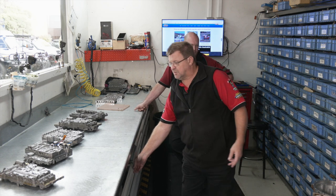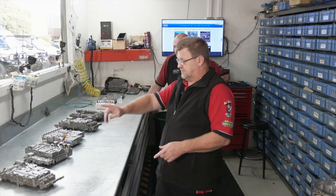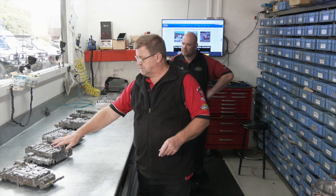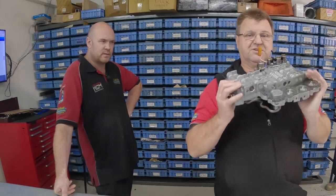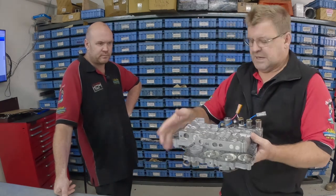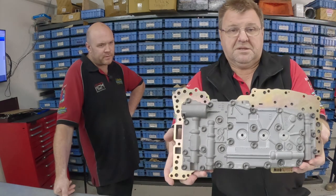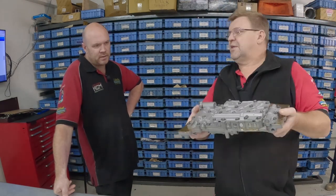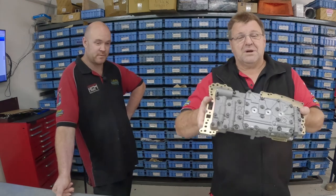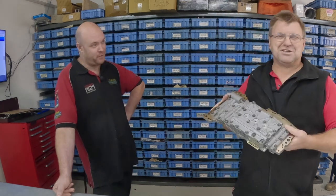In front of me I've got an A750 valve body — this is a Nomad, not an Extreme. Next to it is the GQ/GU — that's a heavy-duty Nomad valve body, which you can also do as an Extreme. It's probably one of the few where we actually change the solenoids, because they're a massive problem on those. The A750 is in the 100 Series, some D-Max five-speeds, the Hilux five-speed, Prado 120 and 150, Suzuki, 200 Series, Pajero — the list just keeps going.